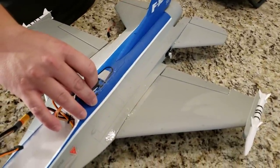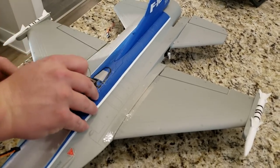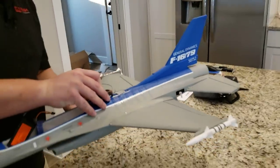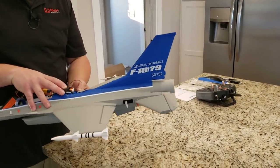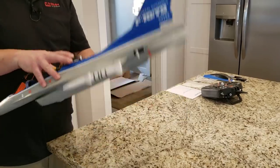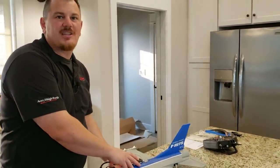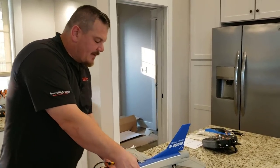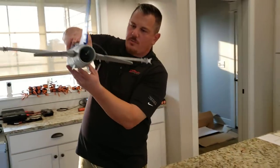But then that's probably going to upset our elevator, okay? So the elevator is still going up and down with the output, but when I pivot the plane, so those sticks, you see how they're moving? When I pivot this plane up, those sticks should go back toward the tail. Yep, see, they're going toward the nose. So now the correction is backwards. But then check this out. Our aileron should be correct.